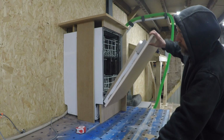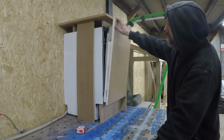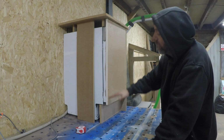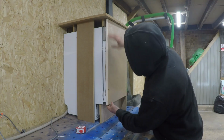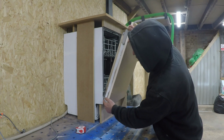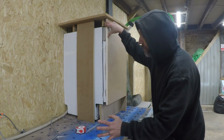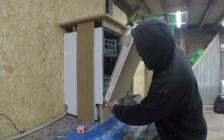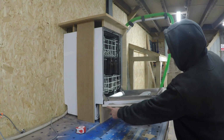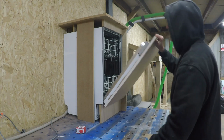When you open the door, it won't even reach it, because as soon as you drop the dishwasher unit, you have to lift the door. So this point here is closer to the knuckle of the dishwasher, and I've fitted dozens of dishwashers, and this has never failed me. So the bottom of your door is closer to the knuckle of the dishwasher, so it's throwing it out less, and in this case it's actually stopping short, because I've got it that low down.